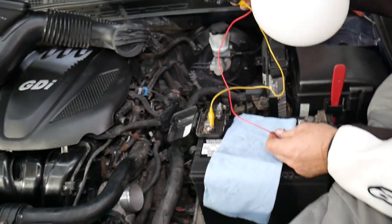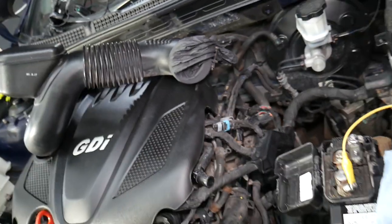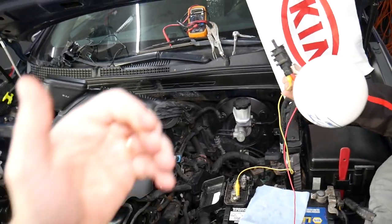That's one good working valve. If you have problems with the engine light being on, check your wiring harness and make sure you don't have a broken fuel vapor line or vacuum line somewhere, because that could trigger the light as well. Hopefully the video will be helpful - thank you for watching and see you next time.